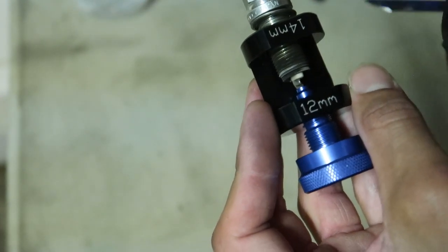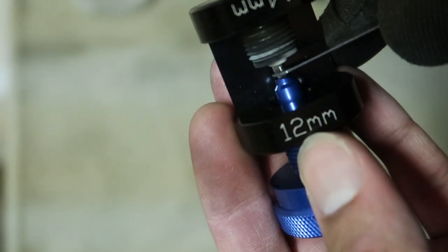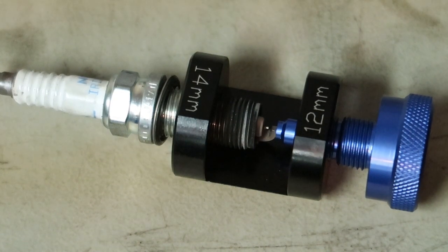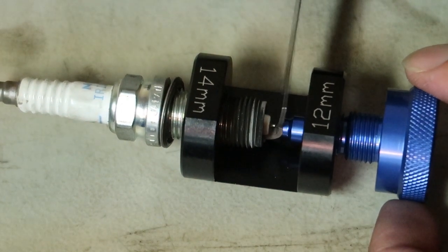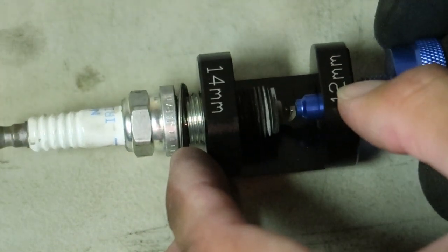So this one doesn't need a gap adjustment. Actually there is a little bit of play — just hard to see on camera. There is the slightest amount of play in there, so I'm going to tighten it down just a little bit. The video doesn't really do it justice here, but now it just fits in there perfectly and there's no play when it goes in. That's exactly what you want. Then you'll take the tension off, take the plug out, reinstall it, and go to the next one. That's simple. Very nice.